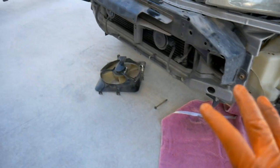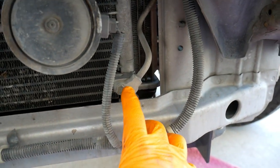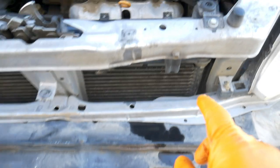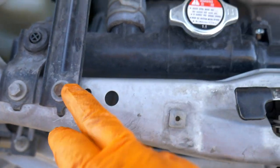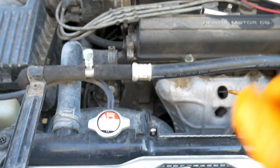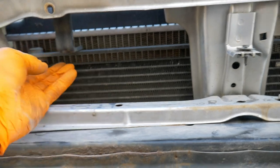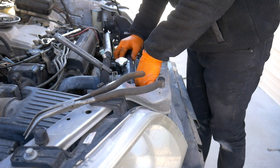So I'm already here — it's not much more work. Remove the 10mm that connects this line to the receiver dryer, this one which goes back to the evaporator core, and once you get those removed, the condenser comes out that way. We're going to take off all these brackets for the radiator and the 10mm bolts. I'm going to see if I can just push this forward — the coolant line might flex with it — and slide the condenser out, then slide the new one back in. There's a 10mm bolt here and here that holds this bracket into place which holds the condenser in. Get that removed and we're going to try to get it out without moving the radiator.